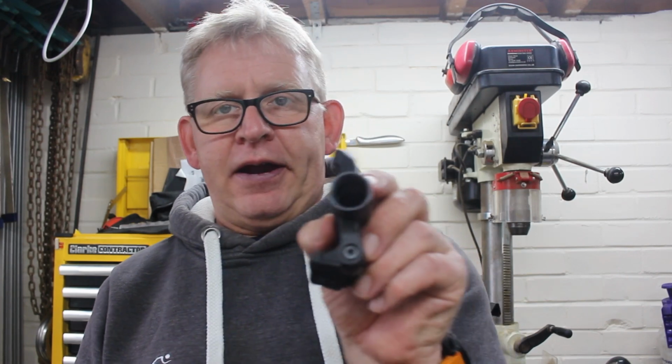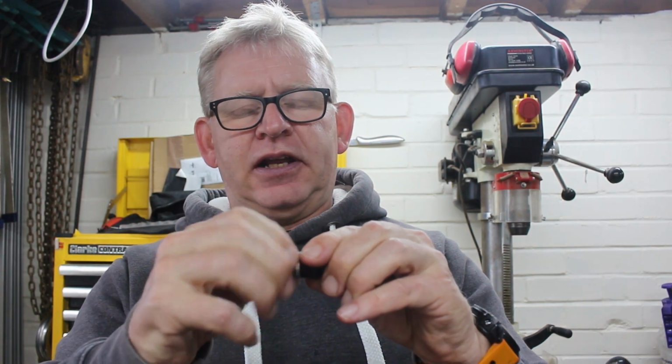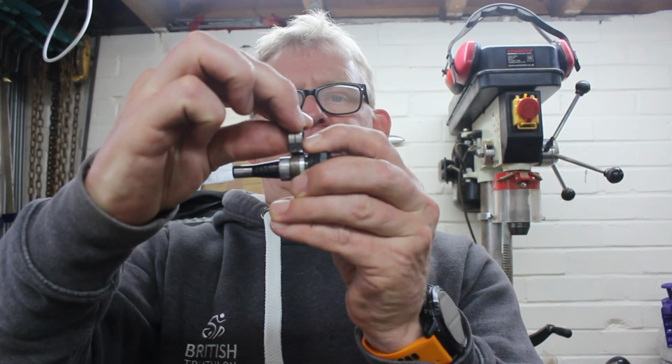These, on the other hand, are the ones that we've got to get on there. So also getting the roller bearing out of there is going to be a bit of a challenge. Now I think the roller bearing is actually okay in these, and it's this bearing here that feels terrible. The other one doesn't feel too bad. It's a little bit noisy, but it's not too bad. So I'm thinking if I take that off and I take that spacer off, then I can fit two of these bearings there. It's whether or not they will actually go on the shaft like that, but they do definitely fit. So I think we're going to have a go at that.